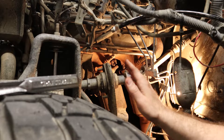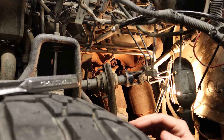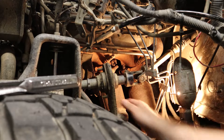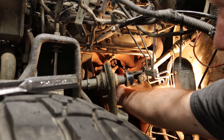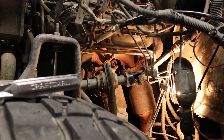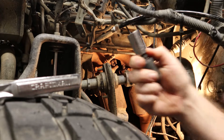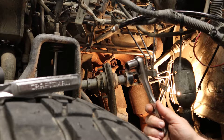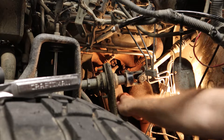So now what I'm doing is I'm trying to get on the bolt heads. I first tried it with a ratcheting wrench, figuring that would give me the most clearance in there, but I can't even get onto the heads because of this shoulder - this lip around this flange. What I found works best: I tried my half-inch with one of these little wobbly guys on it and that did not work - there's not enough room to clear this socket. What I found does fit is a 3/8 ratchet with a standard 15 millimeter socket on it. You can get in there, you can get on the head, as long as you don't drop your tool.